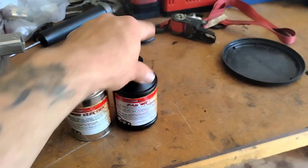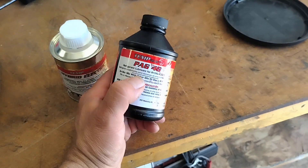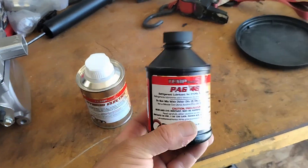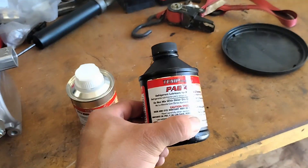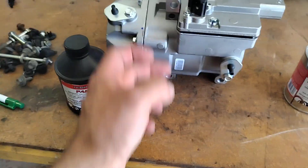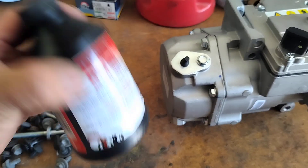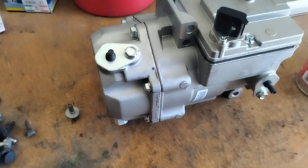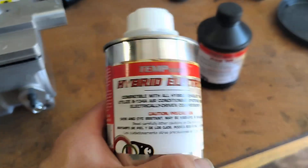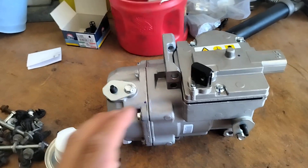It says it's compatible with all hybrid vehicles. The bottom line difference is this normal PAG oil has certain additives and dyes and other things in it, and the thing about it is this can be conductive. If you put this inside of this electrically driven AC compressor, it can actually cause an electric shock through the compressor housing. You add this in, and because it's conductive, electricity can travel through it — you could possibly reach down here and get a really nasty shock. Hybrid electric oil does not have those same additives, and that's one of the first main reasons of safety as to why you've got to make sure you use hybrid electric PAG oil.